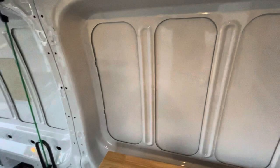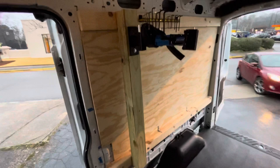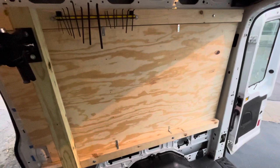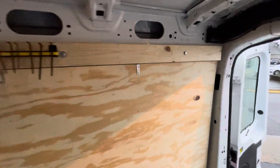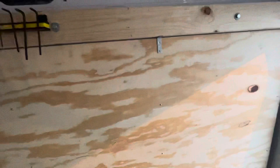You could also build this thing into the curvature of the wall to get some press horizontally out on each side of the van, but I decided that was a waste of time and energy and did the flush mount. This thing seems pretty burly. The M8 bolts that hold these in — the uppers and lowers — I loosened all those when I fit this board in, loosened the bottom too, got the board in there, pressed down from the top, up from the bottom, and cinched everything up. That's the first wall right there.